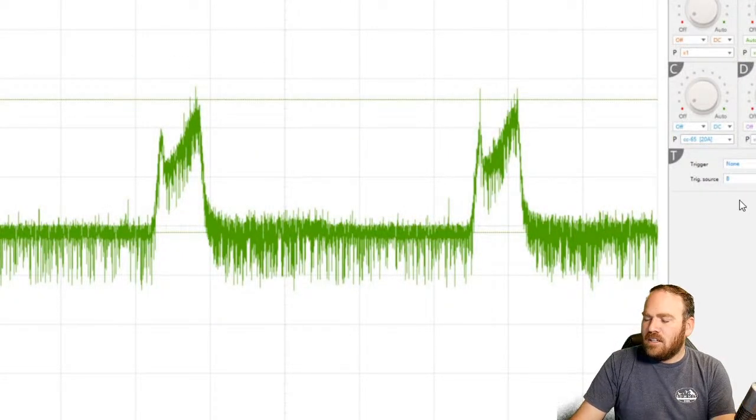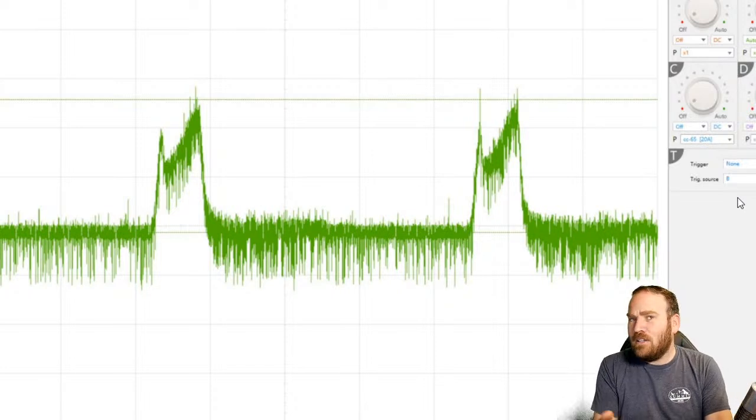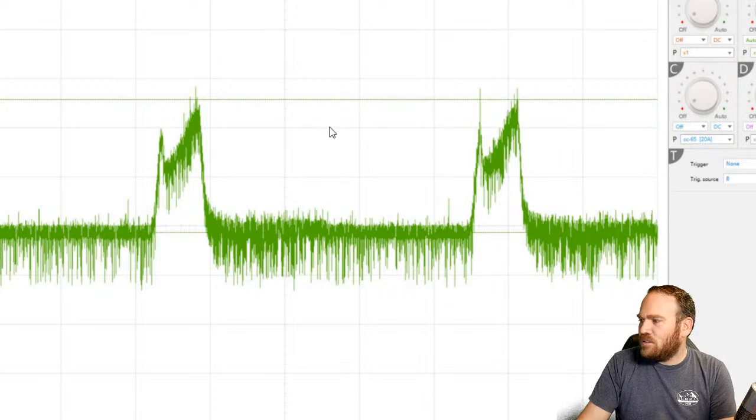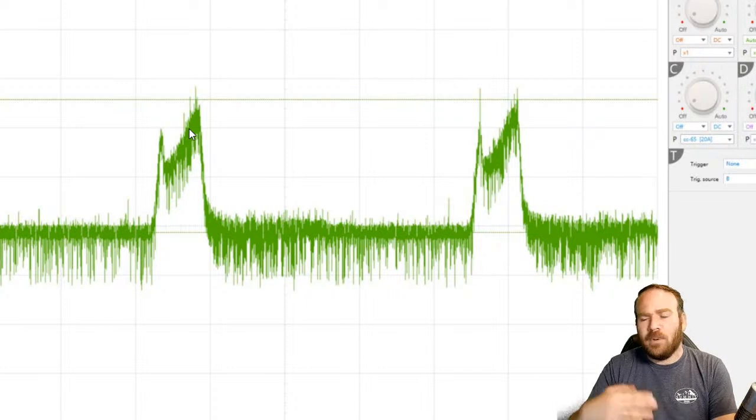So, analog mass airflow sensors. We did analog on week 17 and digital mass airflows on week 18. This Land Cruiser doesn't have both, that's why he skipped week 18. But on analog mass airflow, we see the big jump as it fills the air plenum with air, and then it drops back down. And then we're seeing the gradual increase of airflow into the engine as the RPMs go up, and it drops back down to normal.